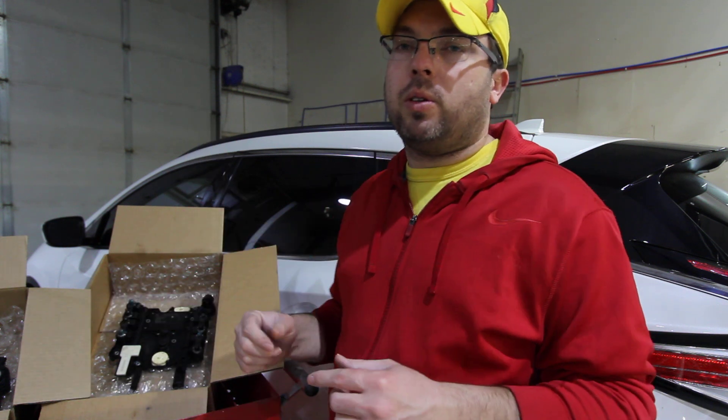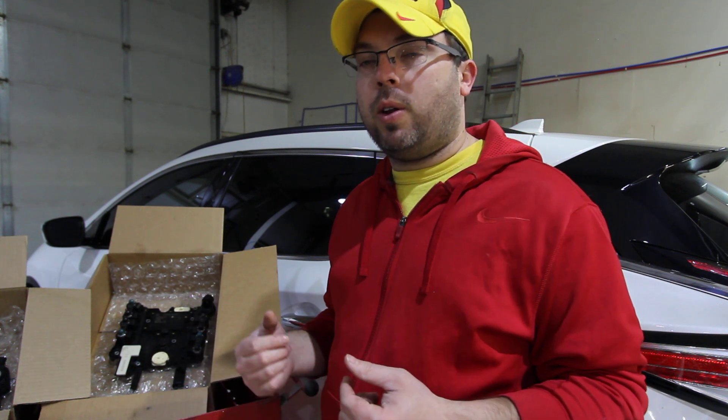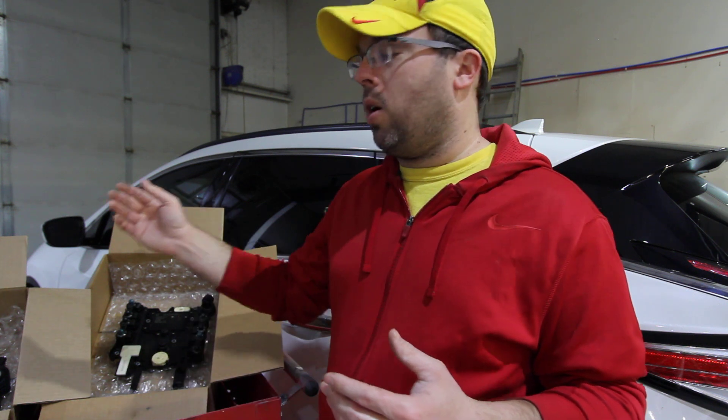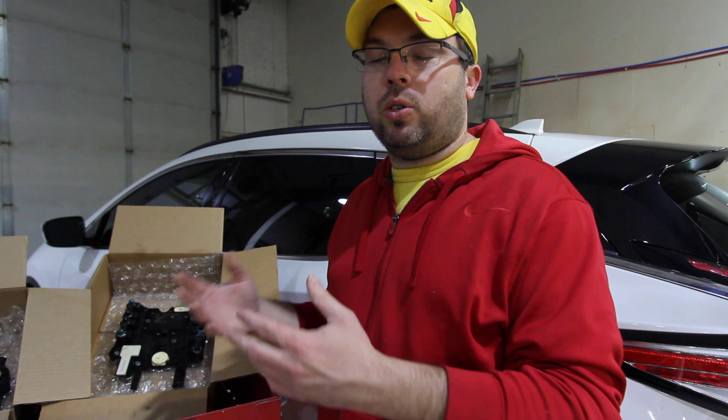There's a whole drive authorization process for the conductor plate — I believe the intelligent servo motor is the same, though I haven't done one of those in a long time. But next time I get one of these cars in, I'm definitely going to do a follow-up video and show you the whole procedure of coding a virginized VGS or ISM back to the car.